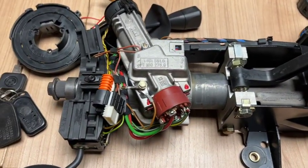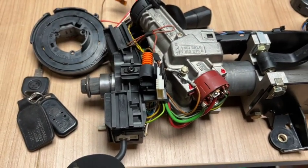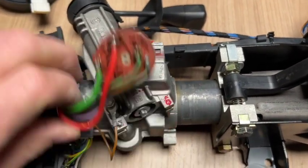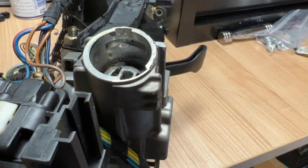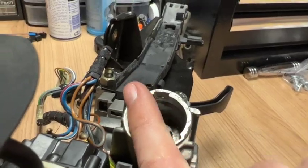This is a complete column and we're going to disassemble it because you don't need any part of the ignition — so all of that end can come out. Very importantly, you also need to take the steering lock pin out. The first part is easy: undo two grub screws and you can remove the socket out of the back and remove all the wiring. For the ignition barrel removal — there are a lot of videos saying how easy it is to use a straightened bobby pin with a slight bend, aligning the key to a certain angle.